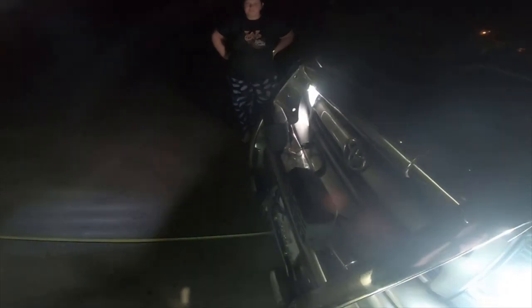Also take a note that you might want to put the measuring tape in a spot either on the outside of the vehicle or in the center of the vehicle and drive slightly over the measuring tape. Take your best guess of where the actual headlight is, because you actually need to measure from the headlight housing all the way to the wall at 25 feet. It's not from your bumper or from the driver's seat or anything like that. You actually have to measure from the actual housing to the wall.